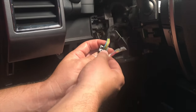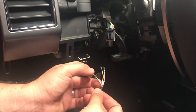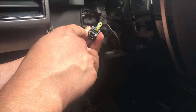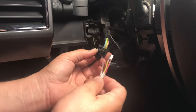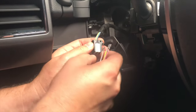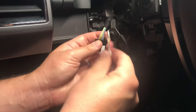The way this harness from Boosted Gray Goose works is that the pins are numbered — you've got 9, 10, and 11 — and they just match up with the corresponding holes on the connector plug. If you look closely in the corners you can see the numbers: 6, 12, 1, 7 — so I have one through six and seven through twelve — just match them to the corresponding holes. To get the pins in, you first have to release this tab here, push it down just a little bit, and that will allow you to push the pins in.